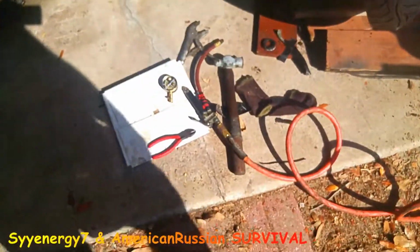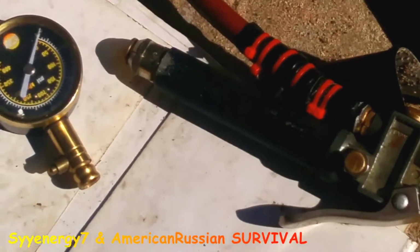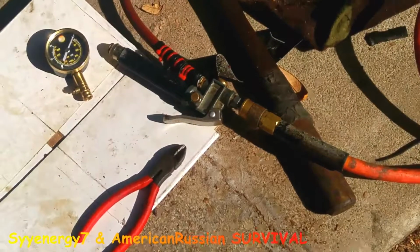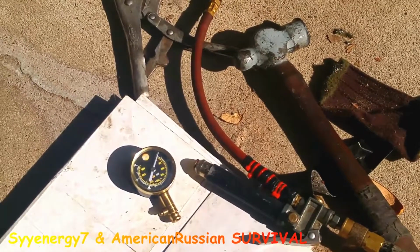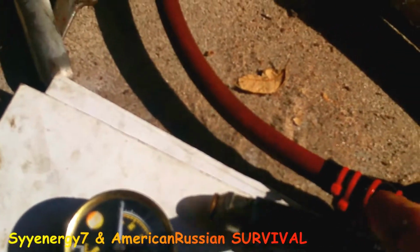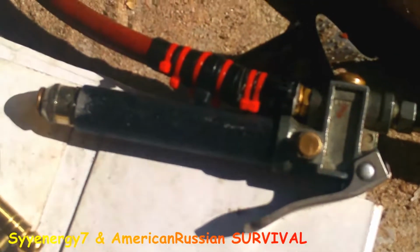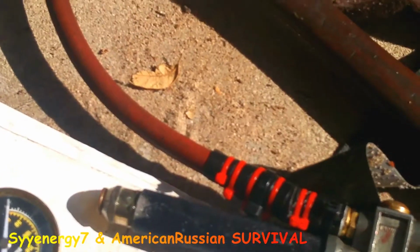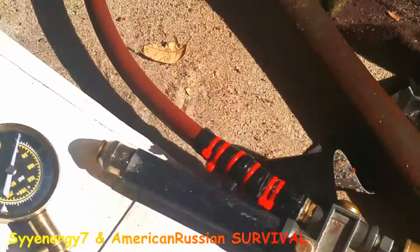And like I said, if you put loads of those clamps on there like that, it makes a huge difference as to how well it seals. Even if there's gas or oil behind it, I'm talking about a temporary fix in that case, say you're stuck on the road. If you really wrap it up good, not just with the tape, but put clamps right next to each other, with the ends staggered, that thing's going to seal up pretty damn good, man. That's what really makes it a lot stronger, because it's basically like having a slew of hose clamps and a heavy rubber wrapping around it. It's not just the glue that's doing it, it's actually like hose clamps.